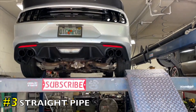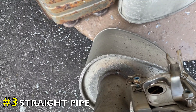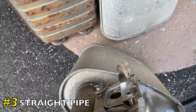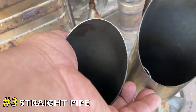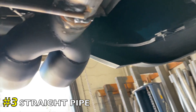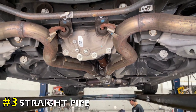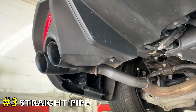There's the resonator that comes on at factory and there's the two mufflers. What you want to do — these ones come with a valve on each of them — so what you do is take the bolts off, plug it back in, and zip-tie it away so the car thinks it's still got it but it doesn't. I'll show you how it looks — we zip-tied it right there. That's it, so it'll just keep going on and off by itself every time it goes into different modes.